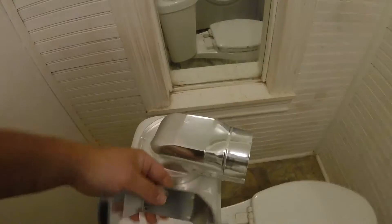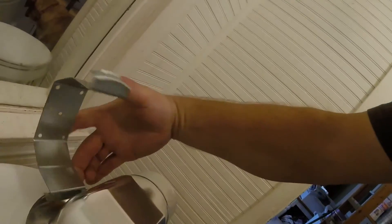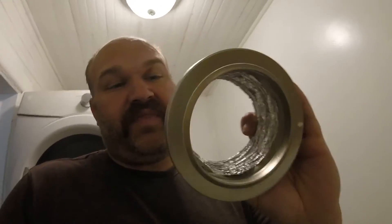As I showed you earlier, this wall mount is where this part clips in — it's all going to magnet together here. The first thing you want to do is clip this in place, then reach it behind your dryer and find the spot on your wall. Our vent is right there, so it looks like this will mount right above that outlet plate and be in line both horizontally and vertically with that once the dryer is scooted back in place. We're going to line it up just with the left side of that outlet, just above. Now that we know where it needs to go, we'll scoot the dryer just a little to make room to screw that bracket into the wall, and then clamp this adapter piece onto the back of our dryer.